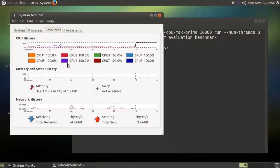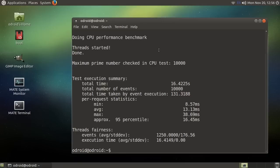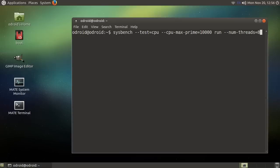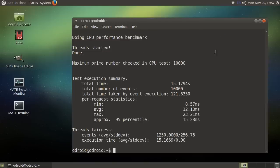A few people asked after my last Odroid XU4 video whether it uses all eight cores together or just the four slower then four faster as in some Android implementations. This test proves it uses all eight cores. Running the actual clean Sysbench test on the Odroid XU4, the result is 15.18 seconds. The little fan goes wild as it gets quite hot running this.